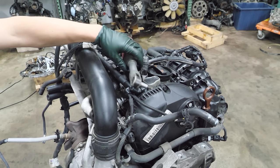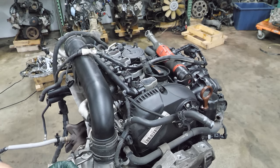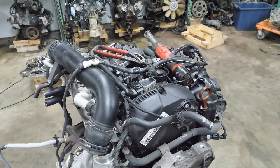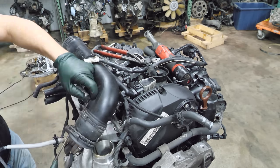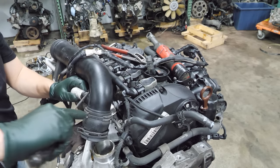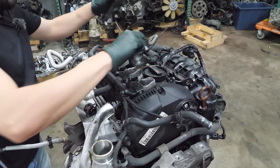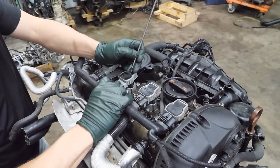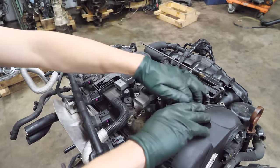The first thing I'm going to do is get this inlet pipe out of the way. I don't Volkswagen very often and I think it shows — it's going to show in this video. I'm just going to break the crankcase vent part because these should be new every time anyway. That took too long, and now we have good access to the coil so we can get the plugs out. These should come right off — they did on the last Volkswagen engine.